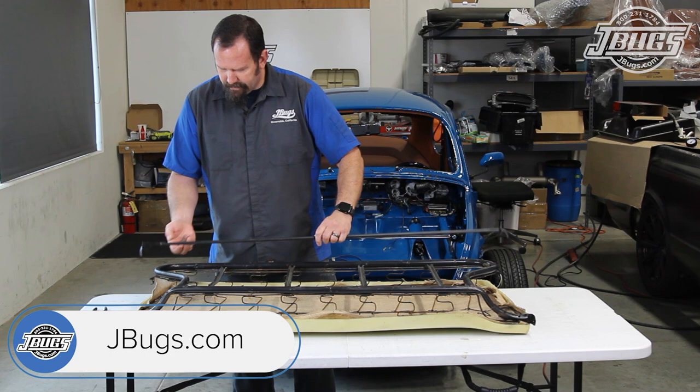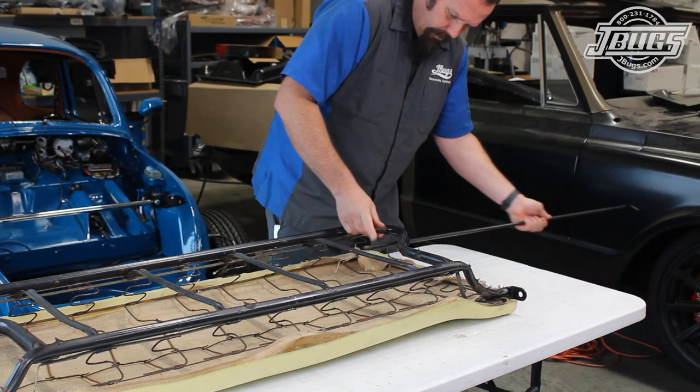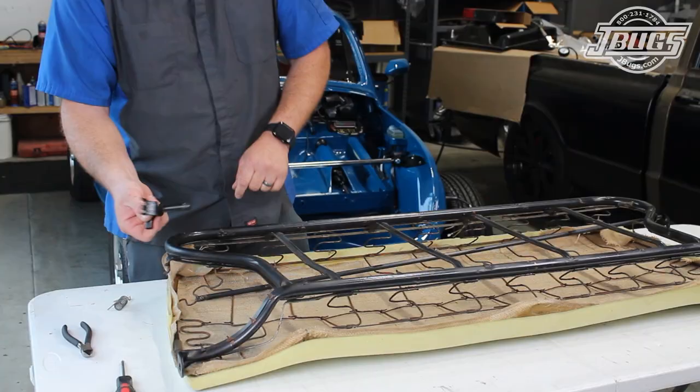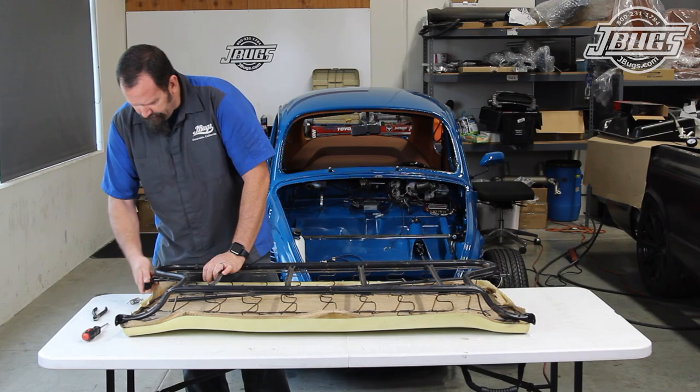upholstery blocking the view. The long portion of the bar with the washer in place installs into the seat backrest through the guide on the passenger side. The end that sticks out of the seat will point towards the front of the car. At the driver's side of the seat, the short end of the bar with the release strap bracket inserts through the guide with the strap portion pointing towards the bottom of the seat. The end of the bar faces towards the front.